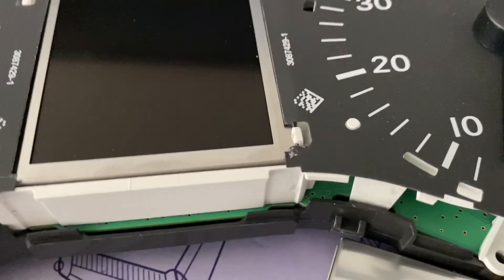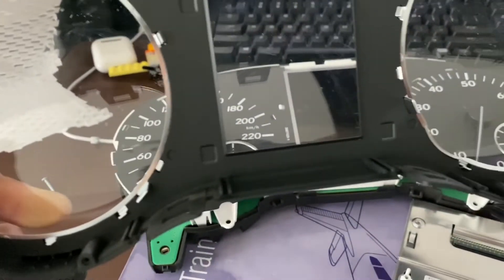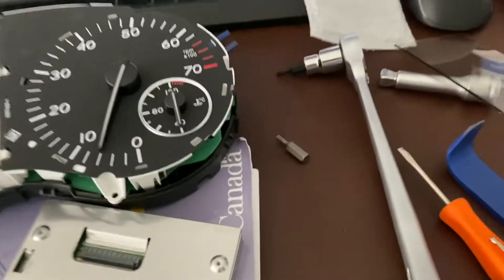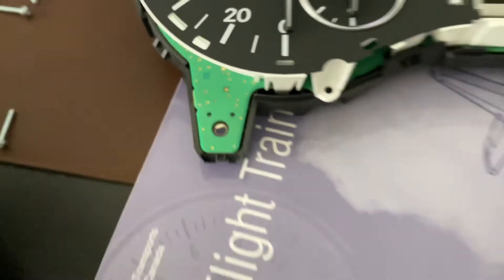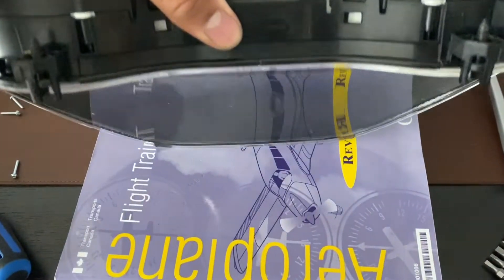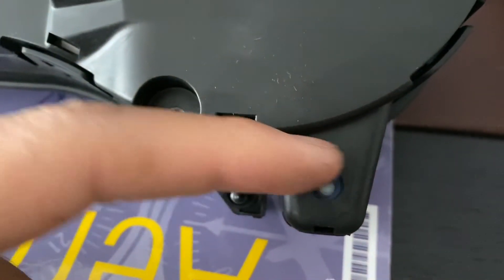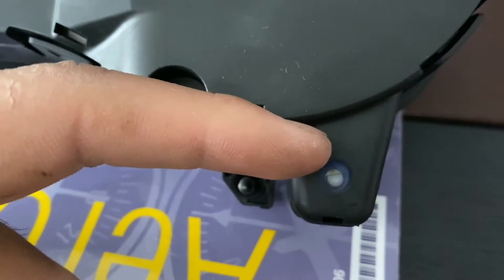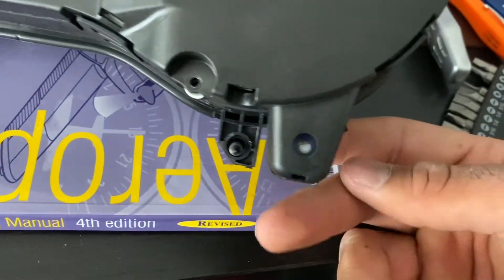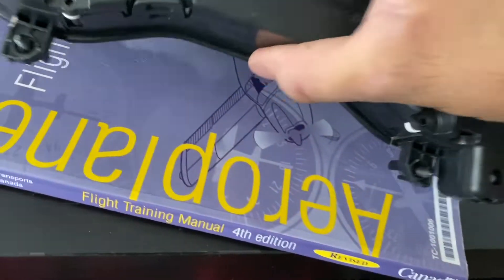This was a real pain. Unfortunately, it did damage that a bit, but I think it'll be hidden by the surround. I'm going to get this back on. What I did was put the plastic part face down and then put the cluster on from the top. You do have to mind that there's a flat spot on the top — you can actually move it from the other side if you need to get it positioned. On the board there's a position it wants to be in, and you can move it from the other side to get it into that position. Screw's back in — we're going to throw it in the truck and see if it works.